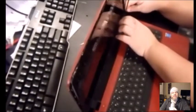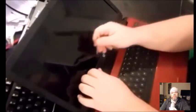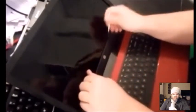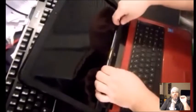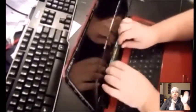After the three sides, work on the two hinges — left and right. You'll sometimes just have to use your screwdriver to pry it open. On the very bottom bezel there's an adhesive holding it to the metal part of the screen, so just feel your way and work at that glue. You'll hear it kind of pop — gently do it, don't force anything too hard. There are two hinges holding the left and right, and the bezel will pop open. This particular HP was literally just a piece of plastic snapped onto the back of the lid.